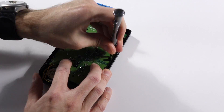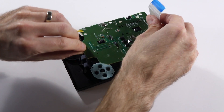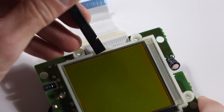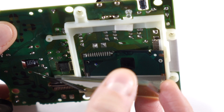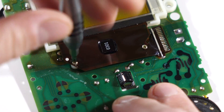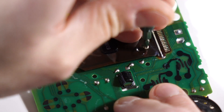Remove the Phillips-head screws that secure the circuit board to the front casing. The board and LCD screen will come out as a single unit. A small amount of adhesive holds the glass LCD to the white plastic frame. Use a spudger to pop the screen from the frame, but be careful — there's a ribbon cable behind the display that's pretty short and soldered to the circuit board. Don't try to pull the screen too far away. Remove the two small screws that secure the bottom ribbon cable to give yourself some extra working room.